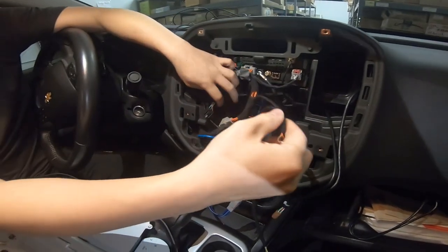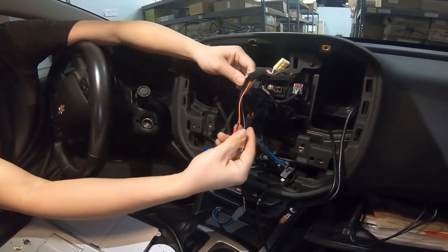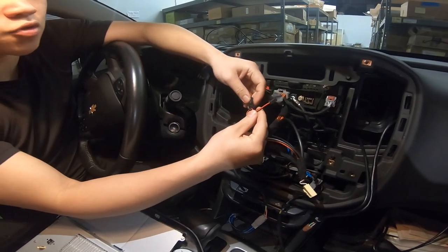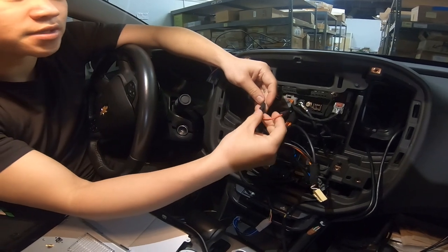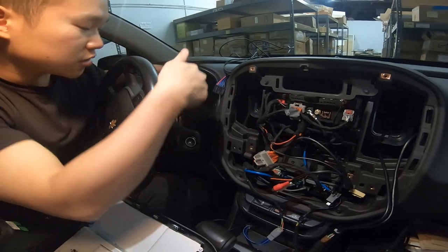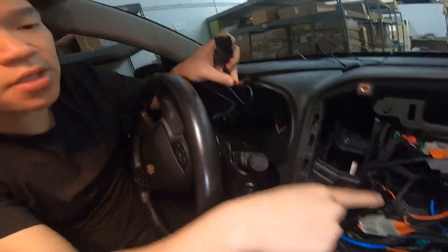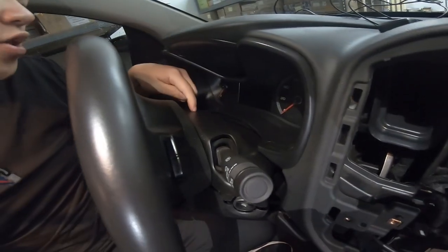After that, you're going to connect your audio. If you don't have this plugged in, you're not going to get sound from Bluetooth or plugging in your phone. You also have this red and black cable — this is for your steering wheel control. You're going to plug one or the other; whichever one gives you the steering wheel controls is the one that works. This connector routes all the way to the top of the steering wheel column.